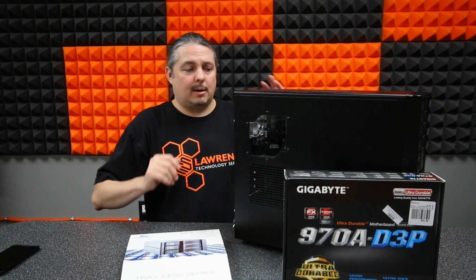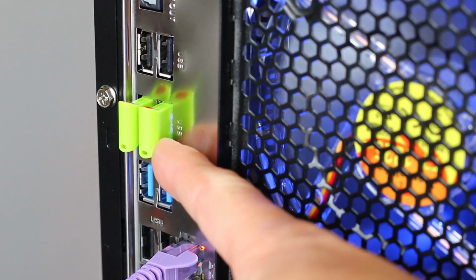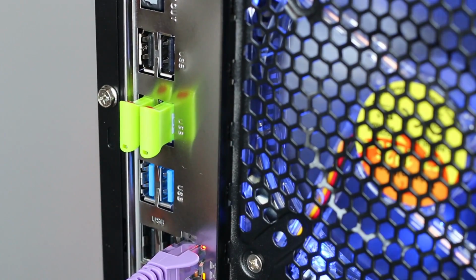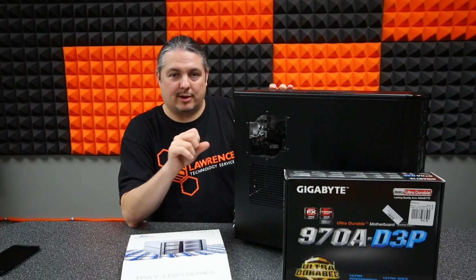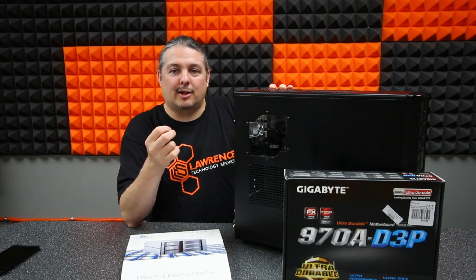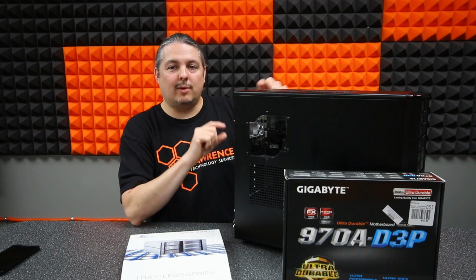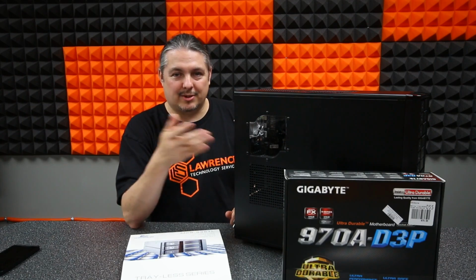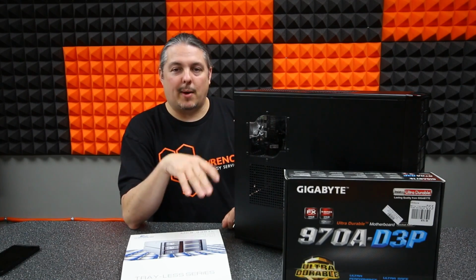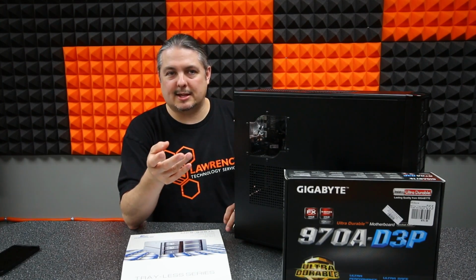Now the other thing we did, and I'm going to show you in the back here, is we went with dual USB. So with these USB thumb drives, when you're running through the install, you select both of the thumb drives for the install, and then it automatically goes, oh, okay, you must want these in a mirror. And it mirrors them for you. So I can remove either one of them and it will still boot. Now if one of them fails, same thing, it still boots up. Now I always recommend you back up and download the configuration file, which FreeNAS makes really easy to set back up.